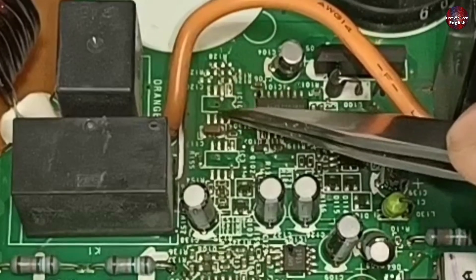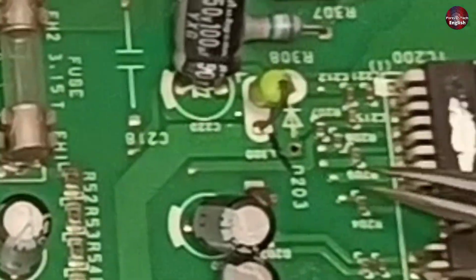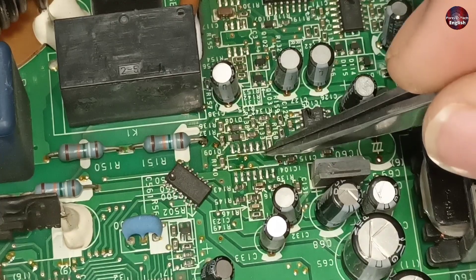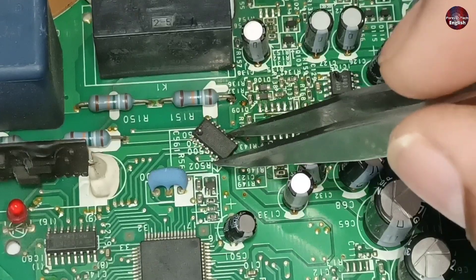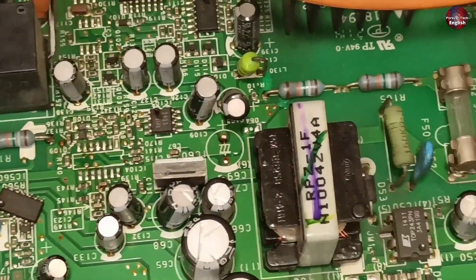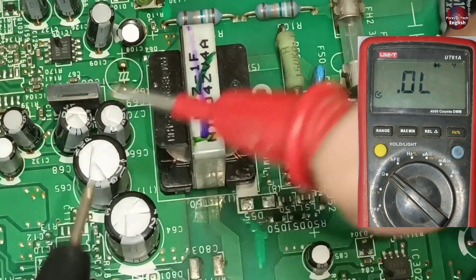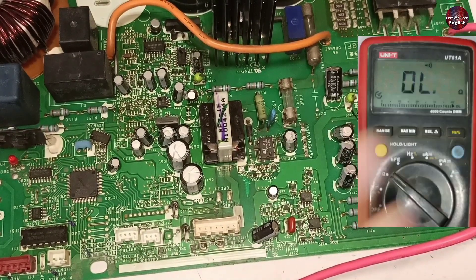I have removed the operational amplifier IC, the other operational amplifier, diode 55, and diode 203 — everywhere that the 15 volts pass through the motherboard, I removed that component. This is a ground sense IC, which detects the AC link and tells the microcontroller that the voltages are passing accurately through the circuit. This ground sense IC is short circuited. Let me show you what happened in the circuit when I removed it — D55 is now showing a diode reading. Whenever this kind of reading is shown with all components installed in the circuit, it doesn't mean it is a short circuit.